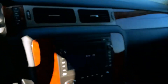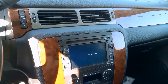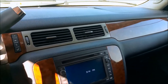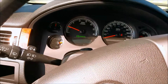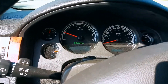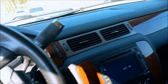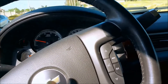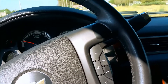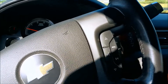We were having a problem when we had the AC running — after about 20 minutes of driving it'll just rev up when you try to go from a stop light. I think I got it fixed — I'll update if not. It might be the hybrid battery in the back, but there haven't been any check engine lights for that. The cooling system warning came up but the fan works, I checked it.